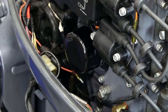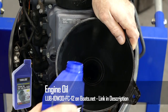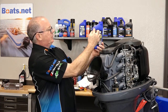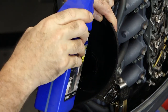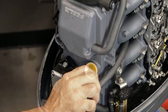There we go. Now let's get a fill back up. As I said in the intro, it holds 1.9 quarts, so that's where we're going to head. So 1.9 — that's one quart. We're going to take it about down to here, and that should do. Plug back in.